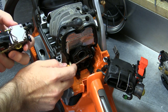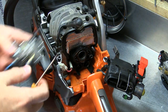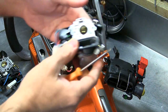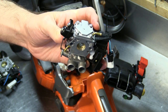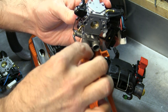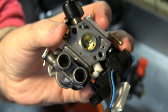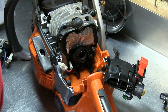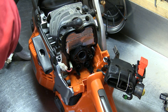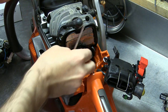See, this nipple goes straight back in here — that's your fuel line — and it mounts into the manifold. The new one is quite different; it mounts kind of downward, so the fuel line comes up like here instead of in like so. You can also see this carburetor has a little flange, a little ring. The new carburetor does not have that, so I made sure to get the ring separately. The ring simply goes into the intake boot here.